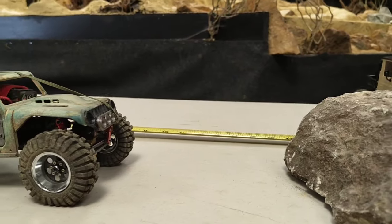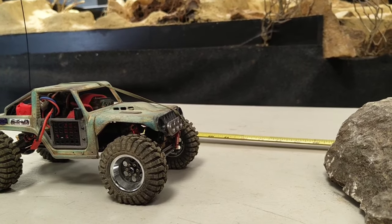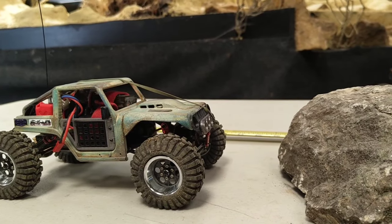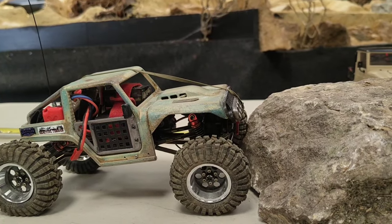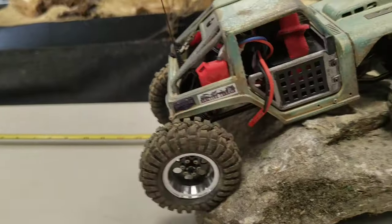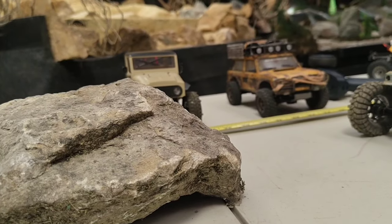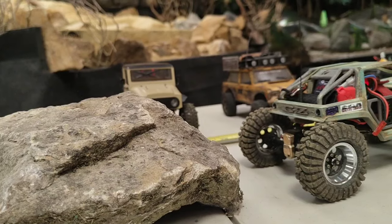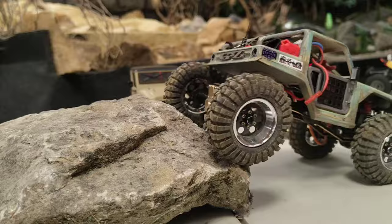So we're going to go back to medium. And again, we're going to squeeze this trigger. Again, noticeably, it changes regarding sensitivity. Again, it's binded up. Very juddery, very bindy, but again for a brush slow crawl, and look, we're talking these ESCs are under £20. I mean, that's ridiculous.